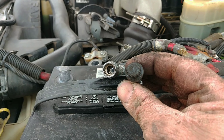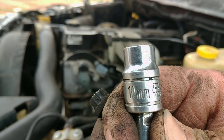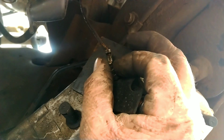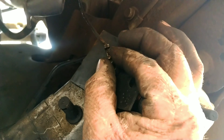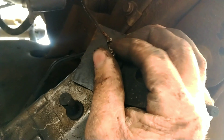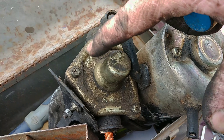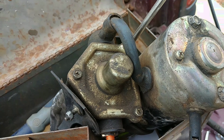So 10 millimeter, that's what you want. I believe this wire is bolted on with an 8 millimeter but I couldn't find it for the life of me, so I just cracked it loose with some pliers — it's not on there very tight, such a small bolt. To rebuild this you got to take off this access plate, which is just some Phillips head screws.